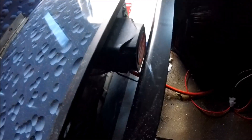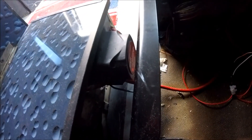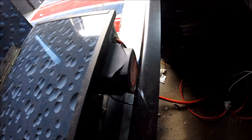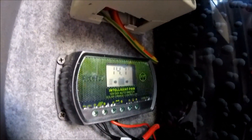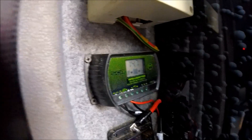Starting the engine — and there's the light just came on, a little red light indicating that charge is now going through into the leisure battery. It also works the other way around: when the solar panel is charging above 13.4 volts into the leisure battery, that will also start charging the starter battery at the same time. Using the solar panel monitor as a battery monitor, you can see it's jumped up to 14.7 volts — that is kicking out maximum charge through to the leisure battery, because both the starter and the leisure battery are already fully charged.